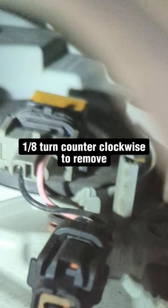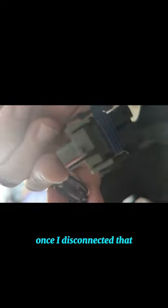Make sure you've got safety glasses on. I couldn't really hold the phone and do it at the same time while holding this thing open, but it was pretty simple. I got in here, disconnected the connector — it has a pink and a black cord. The connector that goes in is facing the rear of the car. Once I disconnected that, I turned the bulb counterclockwise to unlock it and it came out — very simple.